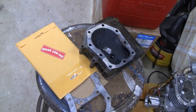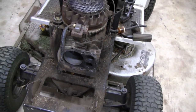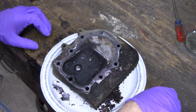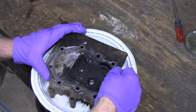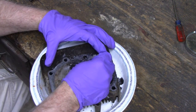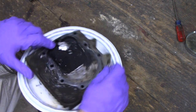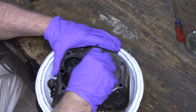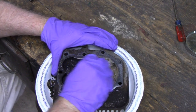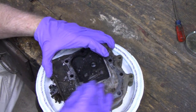I thought I had a little more time, but we don't. So I'm going to clean all that off around the valves and scrape the head gasket off. Same with this - clean the head up - and then we'll grind some valves. Started scraping the head here, the gasket's coming off, not coming off all that easy. I'm trying to get this carbon off too. It's coming off but it's going to take me a little bit, and then we'll just hit it with a wire wheel.